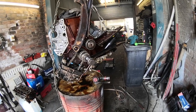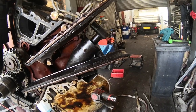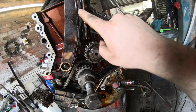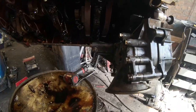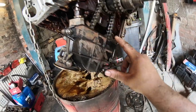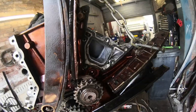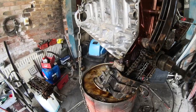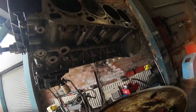Update time, it's about two o'clock. All the lower timing gear and stuff's on. Oil pump and all that sort of stuff's on - that's an oil separator for the crank breather. This is why an M60 doesn't get a timing chain rattle: on the M62, all of that there is one big plastic guide - it breaks, chain goes loose, you do the math. Oil pump just bolts on standard mounts - there's one here, on there, on there, that's all factory. One thing you do have to do - there's a little bolt here that's an oil port on an M62. I just tapped it to M6 and put a bolt in it, as the M60 doesn't use it.